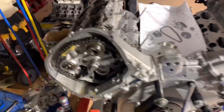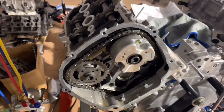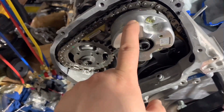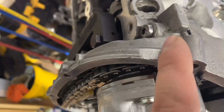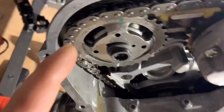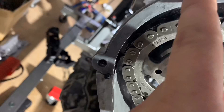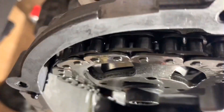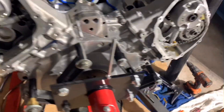The engine is almost done — just putting on the timing set and setting the timing. Everything is in timing position. This is your cam adjuster — the hole is supposed to match with this space on the head, try to be in the middle. Same thing on the exhaust side — you see this mark, it goes in the middle of that head as well. This is the driver side and it's pretty much perfect.